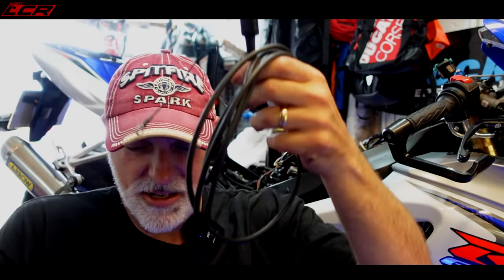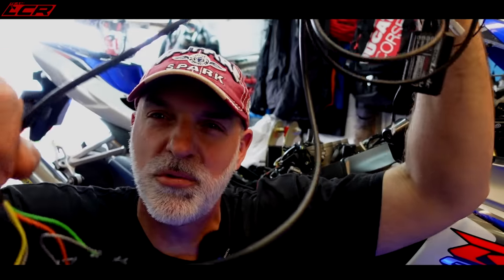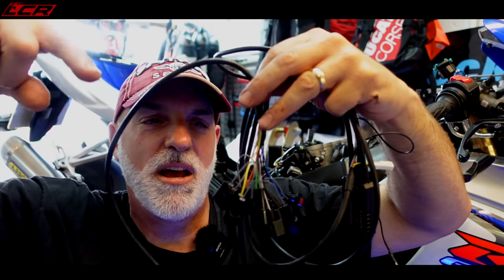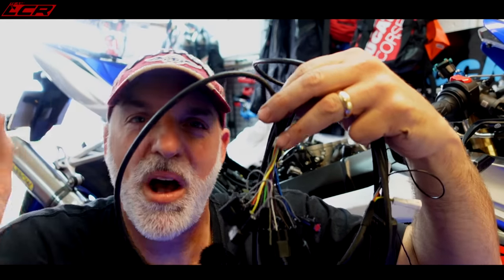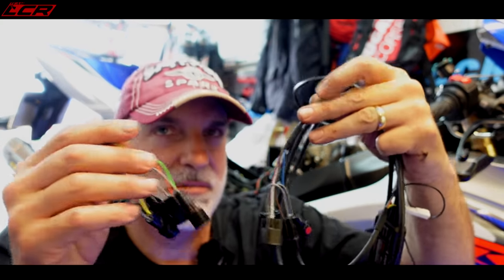So this is the quick shifter. This is the two lots of cable. So it's got two channels, the quick shifter. Basically it adjusts the spark interrupt differently between the two sets of spark plugs. So that's why it makes a nicer shift. It doesn't just cut everything down at once. It staggers the cut time across all of the coil packs.